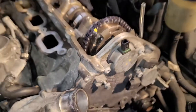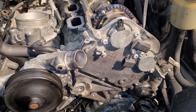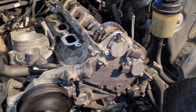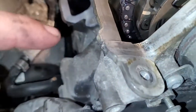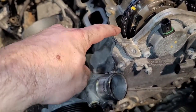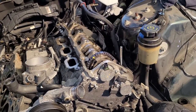Make sure you get enough sealant on there. You can see it oozing out there. Not too much, but not too little either. Put on a you-don't-want-to-do-this-a-second-time amount on there, because it's hard to get to. Easier now. Hard once the whole engine's together. But anyway, now that that is on, got all five bolts cinched down. Make sure that you wipe off any that oozes out here on the valve cover gasket surface on both sides. Later, we will put a new dab on here where this surface meets this surface as we put the valve cover on. Speaking of, I think it's time to put the valve cover on.